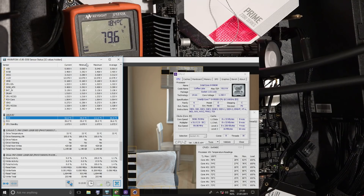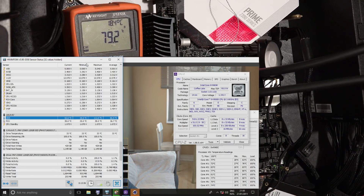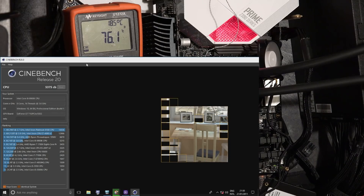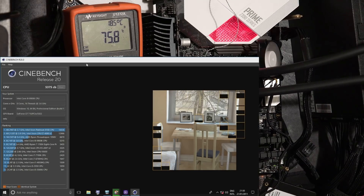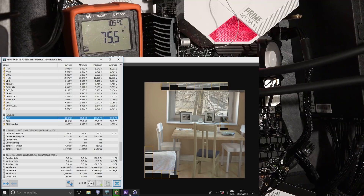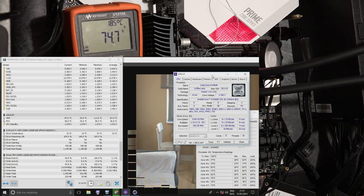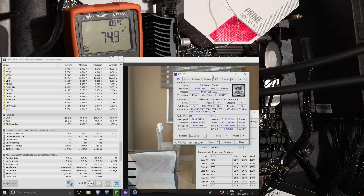We're going to let this run for a bit as the temperature just keeps coming down. I'm going to max the fan out - it's a little over 4000 RPM max full speed, and I still think it's pretty quiet. It's like a Fractal Design 40mm fan that I bought specifically for cooling VRMs on motherboards like this where the heatsink just can't keep up thermally. The temperatures keep coming down and now we're in the low 70s.